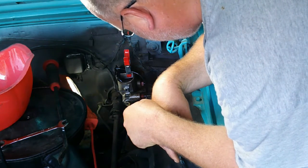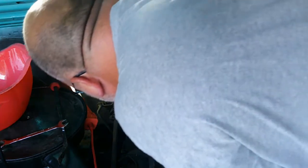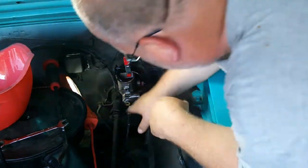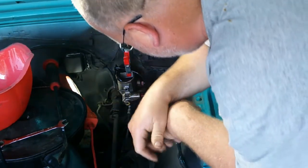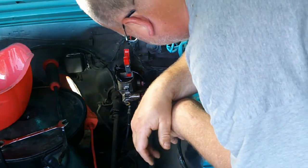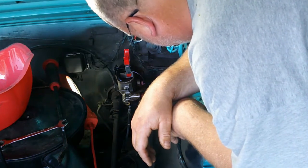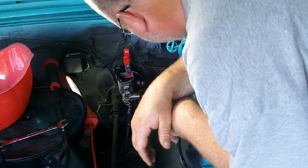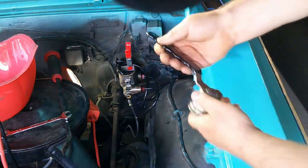I'm looking at things here, and I'm hoping for a miracle, to be honest with you. First of all, I look at this brake line that comes up here, and while I know it's bent the wrong direction and all, it appears that the fitting size may not be the right one. Alright, so I got my bender here, so let's go see if we can't make anything out of this old line. Sure would be nice.